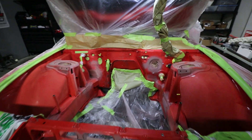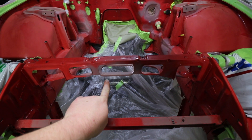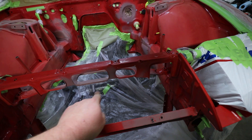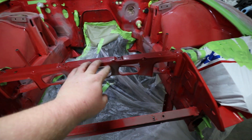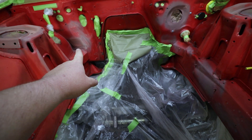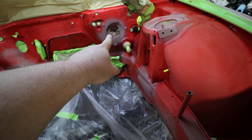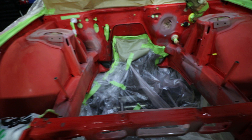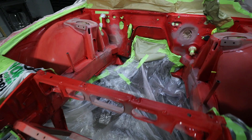Here's the fully prepared engine bay. If you remember from his LS swap, he had put almost a piece of tubing right here so that his intake could come forward. We restored that back to the original crossmember, as well as filled in a hole down there that he had for a battery cable. He also had a few holes for his hydro boost. We filled all the holes, sanded everything down, and Dan — who is definitely the painter of our group — is going to spray it for us.